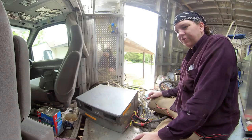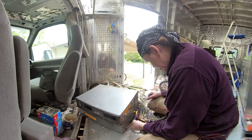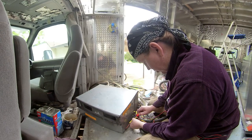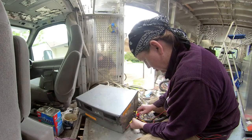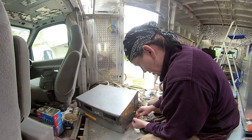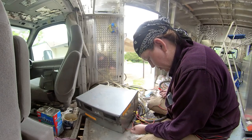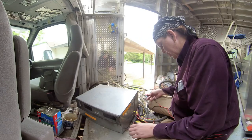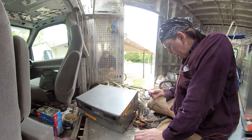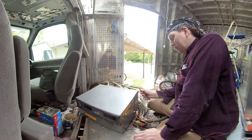I think I can find a new squirrel cage. If we can, that will work for everything. What's this? Blue wire — okay, so that works. Let's see what the blue wire goes to. Blue wire doesn't go to anything, I don't think. Oh boy, that got warm. That might be at the end of its life for this little wire, because this thing got really hot when I was running it just that little bit. Which usually means there's a problem. And being that there's a screaming bearing, it might just need to be replaced.